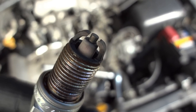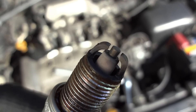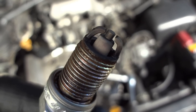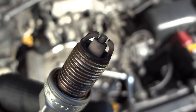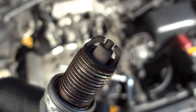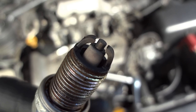It's like blank rotors versus cross-drilled, slotted rotors. There are some people who say that cross-drilled and slotted rotors are great and awesome for your car. But from what I've read, this was used only to help remove the gases released when braking, back when people had asbestos-based brake pads. Nowadays it's no longer needed. The best rotors are the blank ones, because you have more material for heat to escape to, for better dissipation, as well as maintaining higher structural integrity.